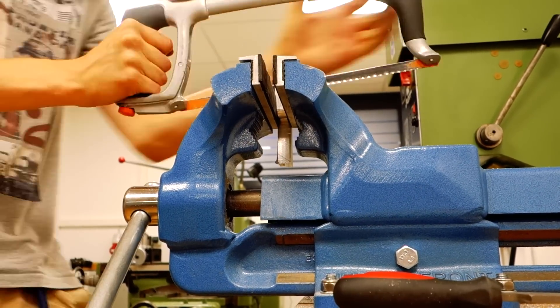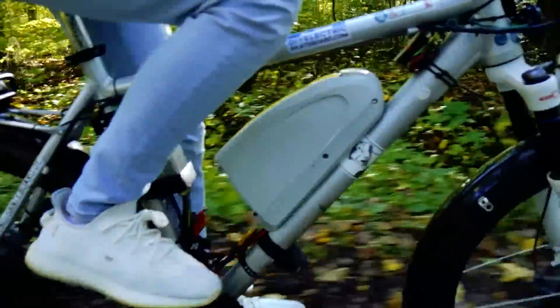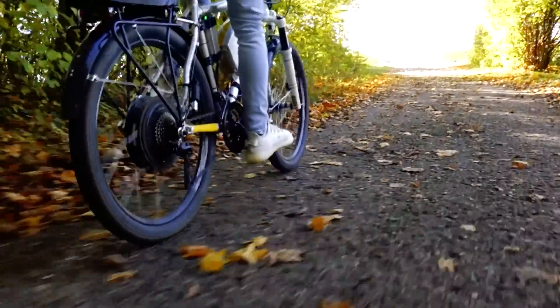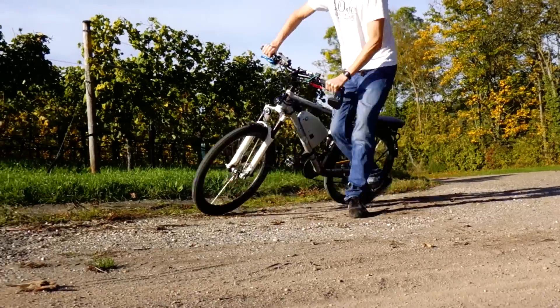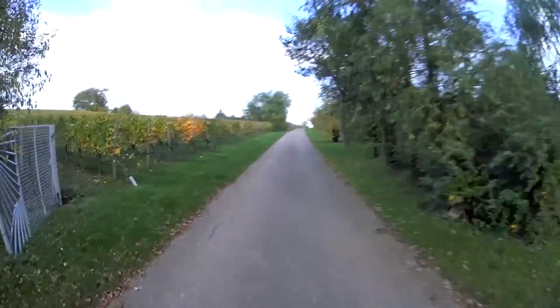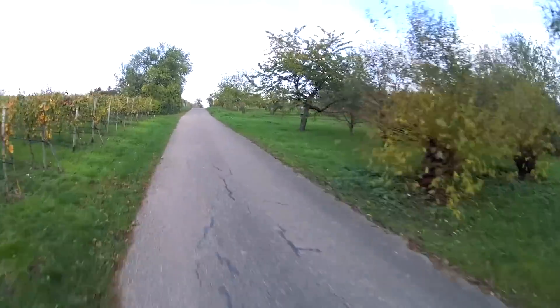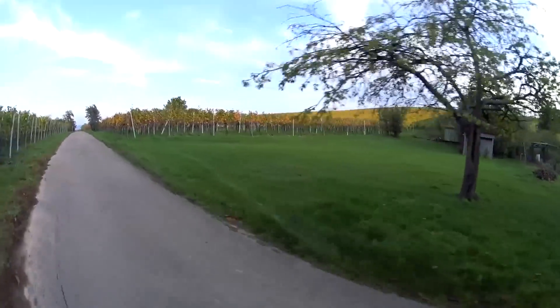So there are basically two big problems with this otherwise really great motor. The first is that there's no easy mount for a torque arm — it relies on the half axle to carry all the torque. The other is that the motor is very weirdly designed: not all rear brake calipers will fit on the disc brake back there, and many people online had to use tons of spacers to make it fit. So I completely skipped the rear disc brake. I have a mechanical brake on the front and only a progressive electrical regenerative brake on the rear, and it works absolutely awesome — you always have enough braking power, and on my commute I rarely use the mechanical brake at all.